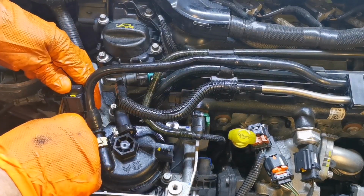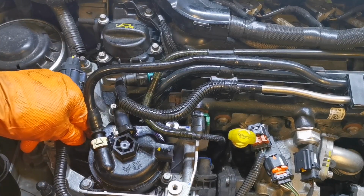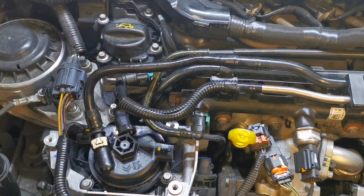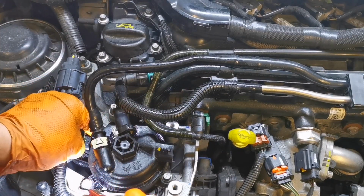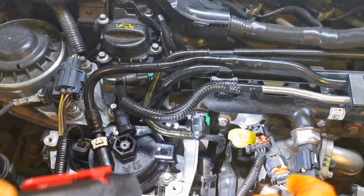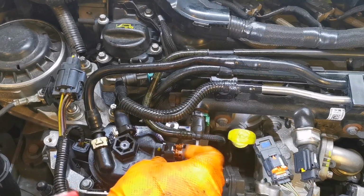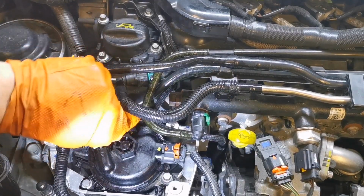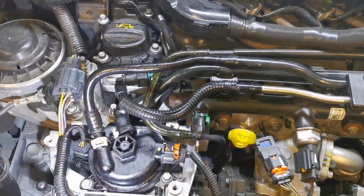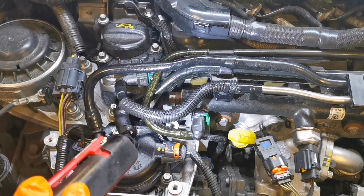Get our electrical plug back into position here again. Down in there, if you can see it. See where it goes. Where's my torch? Our Christmas tree connector. That's her, and not forgetting this, which is probably a water sensor. I'm going to click that back into position again. So that's us. Because we'll have diesel in this bowl, this thing should start no problem. Famous last words.